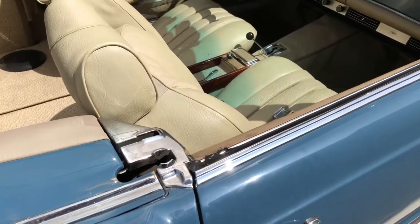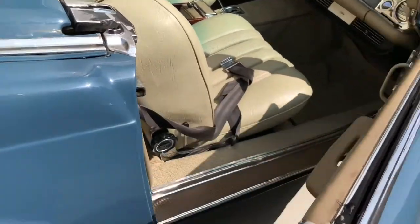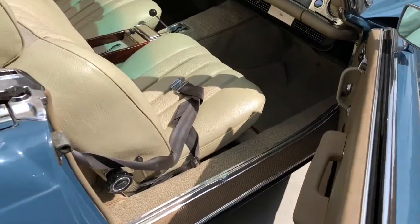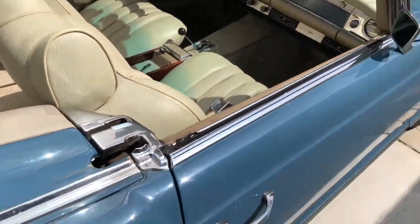When I open and close the passenger side door, it aligns nicely, but when you close it, it sounds really tinny. I looked at the seals and it looks like they're pushed in and worn, so that may be coming from that. But other than that, it closes nice and tight, and the shut line does match up.